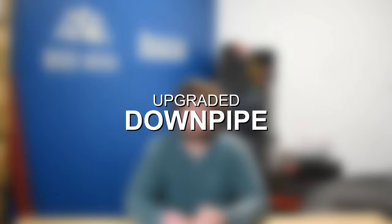At number three on the list, we have a downpipe upgrade for the BMW N20 engine. Following a tune, a downpipe is likely the next best bang for your buck upgrade. A downpipe is going to run a few hundred dollars, somewhere in that $250 to $400 price point, maybe a little bit more if you get into catted options. A downpipe can show power gains of about 10 to 20 wheel horsepower and pretty similar torque, maybe closer to that 15 to 20 wheel torque ballpark — incredibly impressive gains for a few hundred dollar mod. Additionally, there are extra benefits: you'll notice faster turbo spool, a downpipe makes the turbo's job easier to build and hold boost, it also reduces back pressure, which takes stress off the engine, and it's typically safer and healthier for the engine and turbocharger itself.